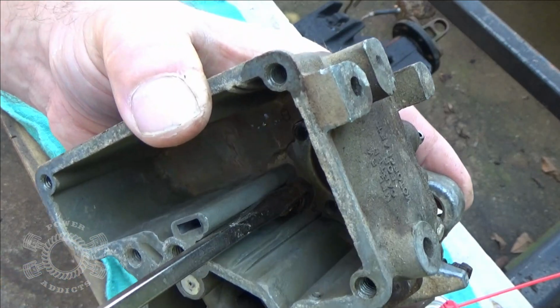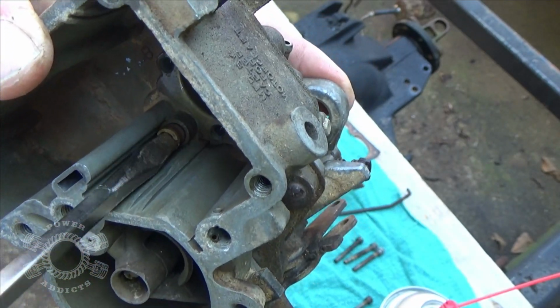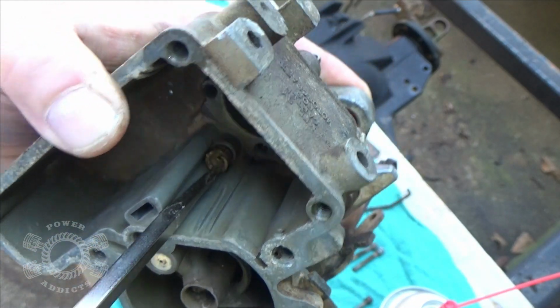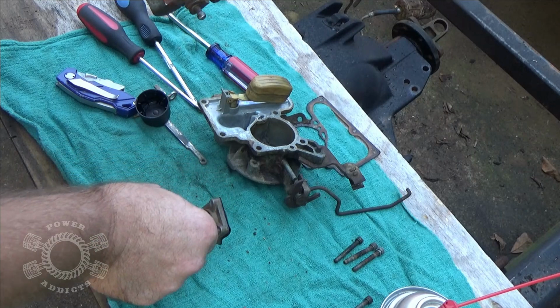And with this side right here, like I said, this carburetor's been into before. This side's broken where somebody seriously over torqued it. You don't need these things tight, people. Just right there, it just made contact. And I'm going to hang the screwdriver on the side of the lip right here and just give it a snug. You don't over torque those. It's not necessary. I have been building carburetors since before I was legal to drive.